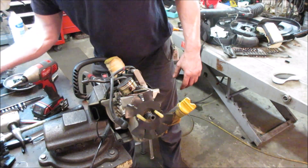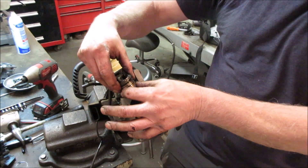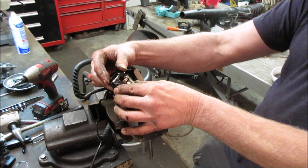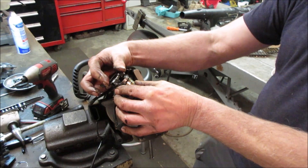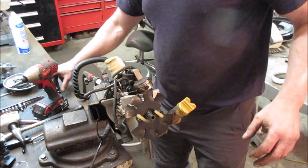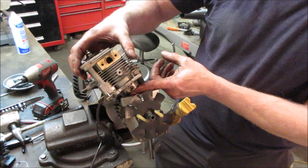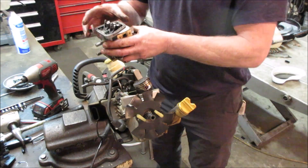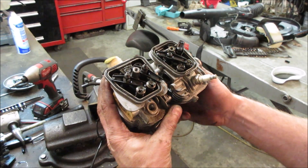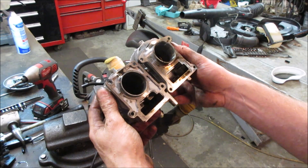There's our piston. I think it is a hair bigger - I think it's a little bigger. We were so close. It is about 95% the size - about 10% difference. We were close. Actually, here's the jug of the one that we want to save. This is going to be too sloppy in the hole. Oh well. Let's go take a quick look at the two cylinder heads - this one we just took off. You can even see the bore - this one's a little bit bigger. The bolt pattern's different too - we're not going to be able to swap much to get them to work.